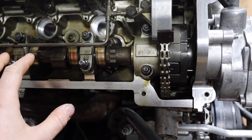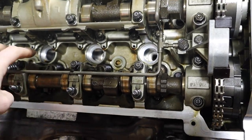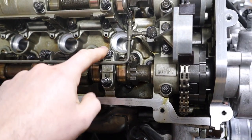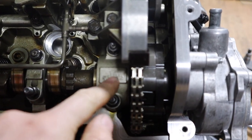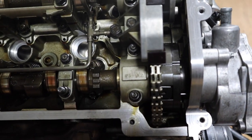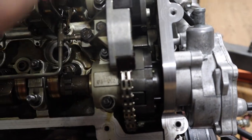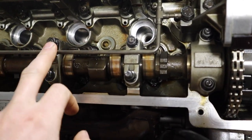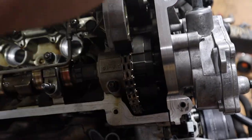So pretty much once you put this on, then you put this camshaft on the exhaust side. Make sure the cylinder's lobes are facing up, so you're not pushing against any valves when you tighten these caps. And the caps have numbers on them, so you can't mismatch them. They're labeled one through five, and they're facing up. Then obviously you've got the oil tube, these brackets that hold, then this little guide, then bolts.